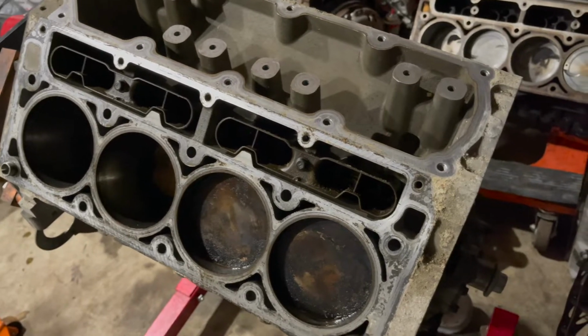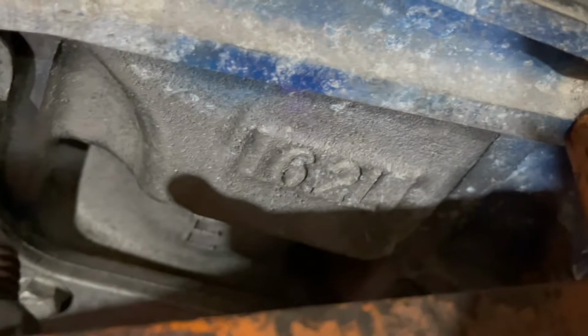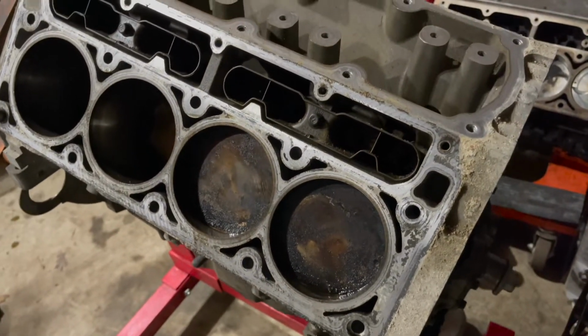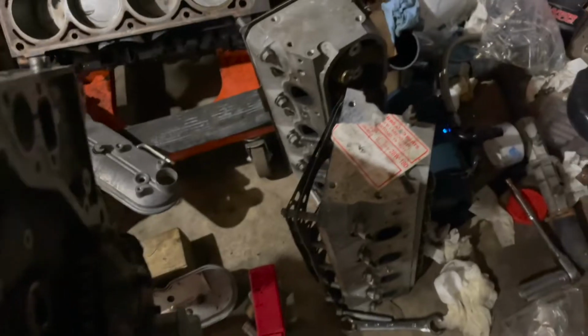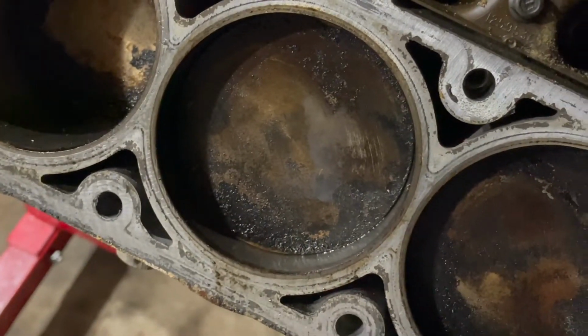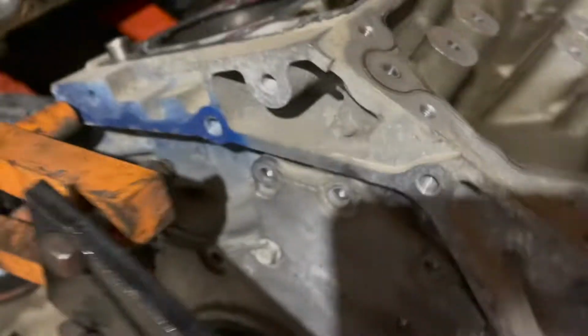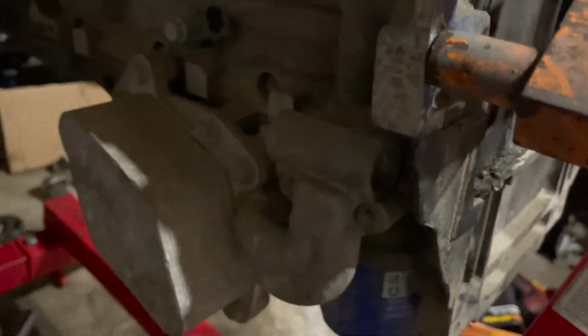As you'll be able to see right here, everything with it is good. It's low miles and it has flat top pistons, which hints that it's from a Camaro or Corvette, which this one actually was from, a Camaro 5th gen manual car. It had super low miles, great cross hatching, and all of that little carbon on the top just literally wiped off with WD-40, which was amazing to me. So whoever had it took really good care of it.